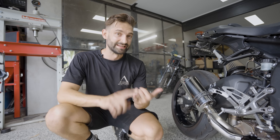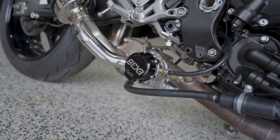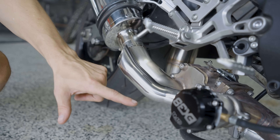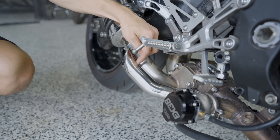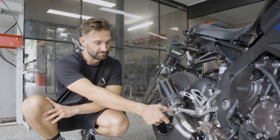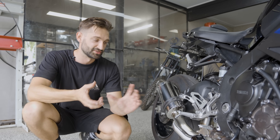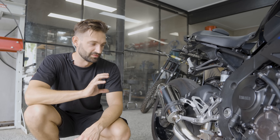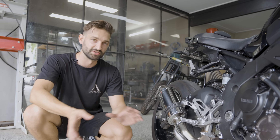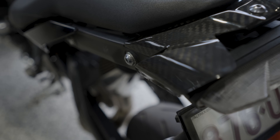A couple of other things we upgraded were the intake, getting it well away from the headers, and then we've also fitted an external wastegate, which was a request from our customer. The turbos as they come have an internal wastegate that we've welded shut and plumbed in this external one. We built two setups: one is the dump-to-atmosphere pipe, and for street legality we've also made a plumbed-back-in-to-the-muffler setup. With a couple of bolts and a few clamps, Cassidy can swap that straight on.